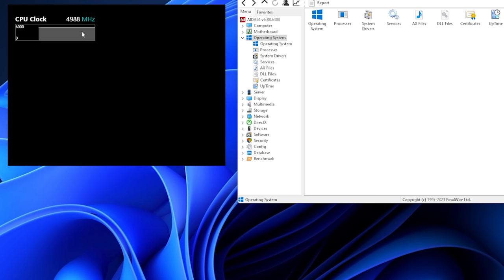If we go to Sensor Panel Manager, you can see it showing right here what they are based on the label we made — so there's the 12900K CPU clock and then there's the RTX 3080 Ti we just added. So now we're going to copy the CPU clock graph — you can tell it's a graph by the icon right there. Highlight it, come down here, say Duplicate, and then we can move this down so it's right underneath the GPU text item. Now we do need to move it — I'm going to just line this up right under there. Now we need that to actually be referencing the GPU clock, so right-click, Modify, and look for GPU clock — that's what we're referencing now for our graph.